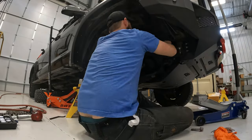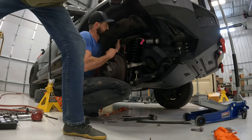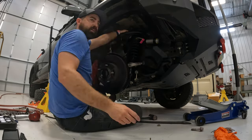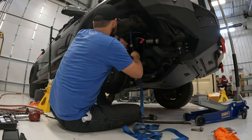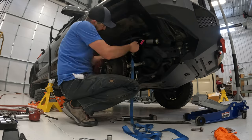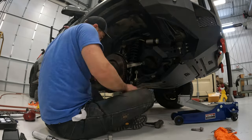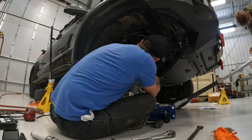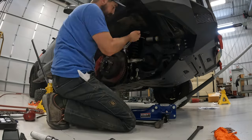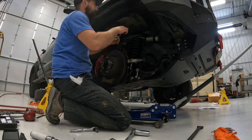You can see my little helper here being very safe with their safety glasses. Here I'm using that strap to bring the lower and upper control arms closer together so I can fit the bolt through — that proved to be very helpful. Then I was using the jack to lift up the whole assembly to be able to put the steering sway bar back in.